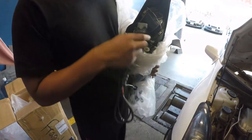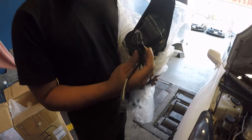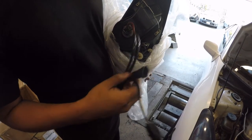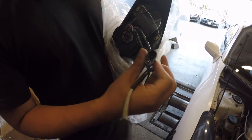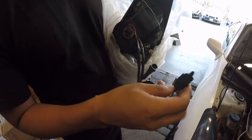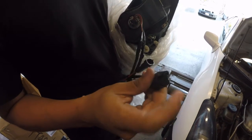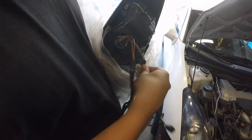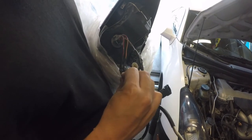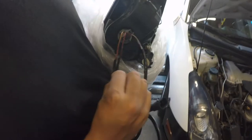You do need the piggyback for the other one, which is this one for the HID. And like I said, on the OEM, you have a high beam and a low beam. I made my own plug, my own wire harness, from eBay. I'll put a link below of the parts I bought. Basically, you just buy the female for this one and the male for this one. And yeah, I did a shitty job on it. I didn't solder it like you're supposed to or clip it. I just did the old-fashioned way of twist and black tape.